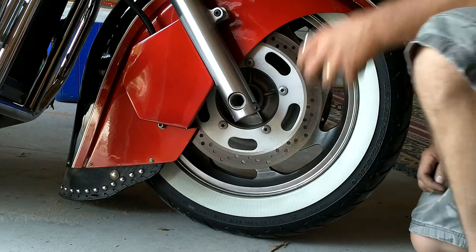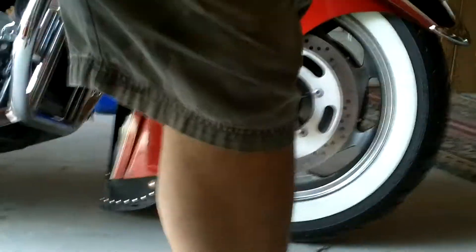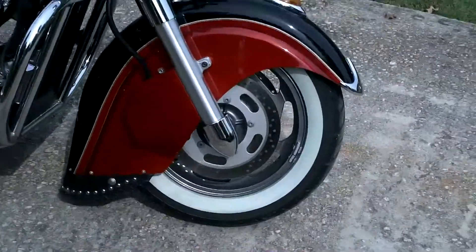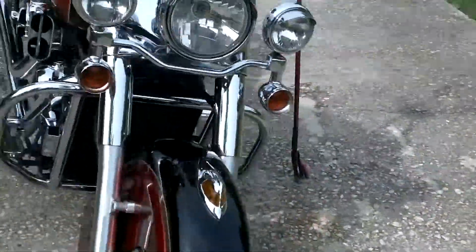I'm going to show you when I'm done. KWatt here. Got the caps installed. Essentially all you do is you line them up, take the retention screws out of it, do a little punch on your fork, and just drill in just a hair so that the little retention screws got something to grab onto. Slip it up on there, put a little thread lock or airplane glue on the retention bolts, screw it in there, tighten it up — good to go. This is what it looks like. It's a 2006 Vulcan I've been working on forever, putting little bits and pieces on.